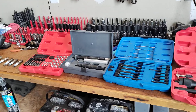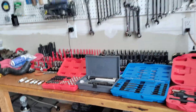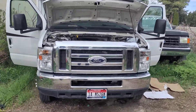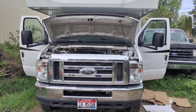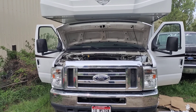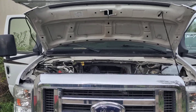If you know what we're looking at, then you know that we're getting ready to drill out the infamous Ford Triton spark plugs. I introduced everybody to Rosie. I've been working on so much stuff, I don't remember. This is Rosie, and Rosie unfortunately decided to blow her transmission cooler, which sits in the radiator, so we're doing a full service — intake removal, all of the hoses, new reservoir. The whole coolant system is being replaced, and part of that job required us to remove the spark plugs and the ignition coils.